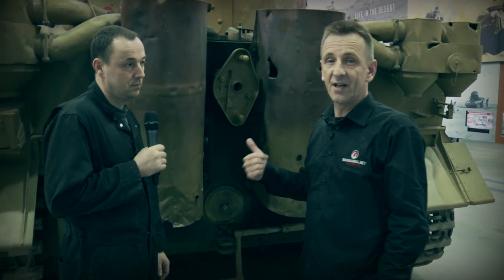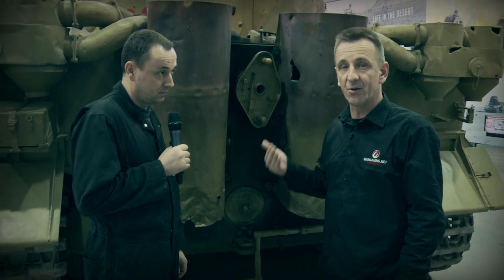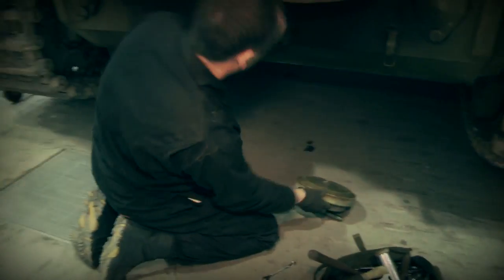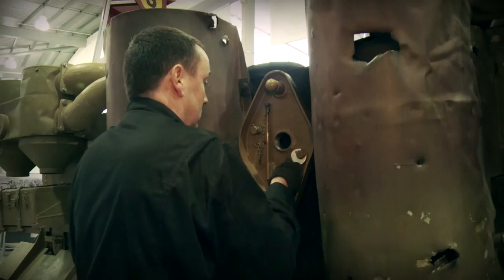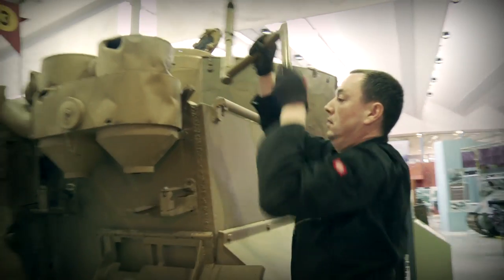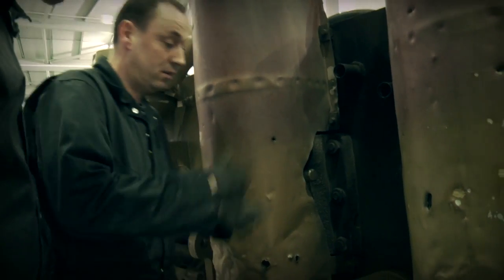There were two ways to start the Tiger 1. The first was a very traditional method using the electronic start in the driver's cab, and the other way was to do an inertia start. Ian's now going to take us through and demonstrate how you'd do an inertia start. First of all we have the access cover — that has to be removed. Then we've got the adapter plate for the inertia starter handle, and mounted lower down is the actual handle for the inertia starter. Then you push that keyway in and it engages the starter on a flywheel.